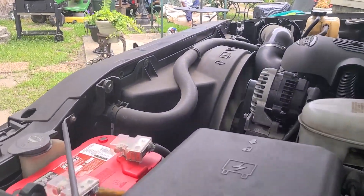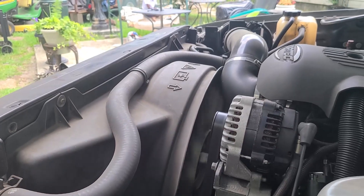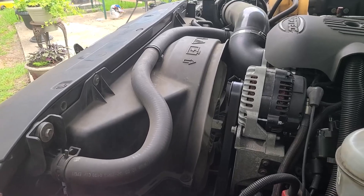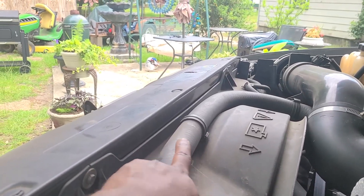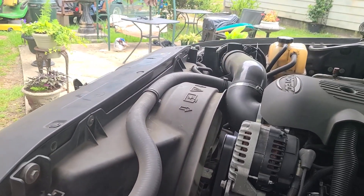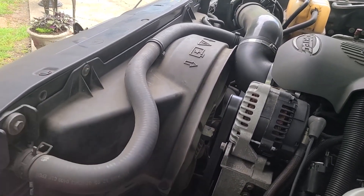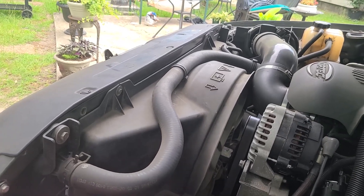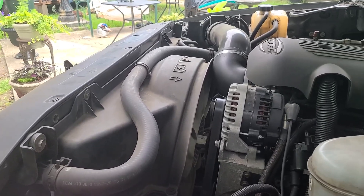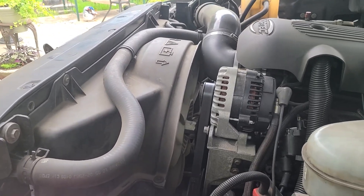Let's get that right. This is what we sound like right now. I'm going to blow some wind though — I feel it all over here. So what I'm going to have to do first is unclamp this hose right here, take the fan shroud off, knock this fan clutch out — that's what we're trying to get off. Wire it up, throw the fans in, plug it up, crank this thing up, and go on about my business. That's all it is to it. You're going to think you can't do it this way until you see this video, and then go do yours. What you waiting on? Let's get to it.